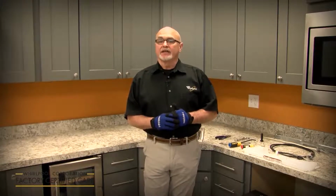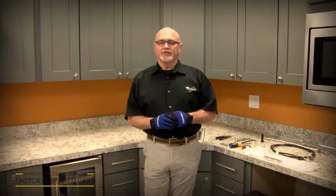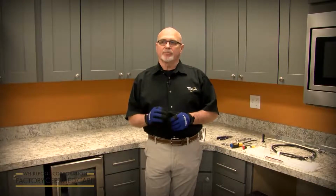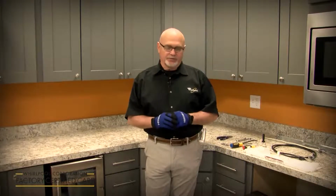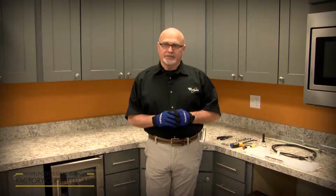We've got a taller tub. The drain hose connection is new. It's got a 110-degree elbow. We've got 4 new insulation anchor points for the insulation blanket that goes around the dishwasher, so when you push it in the cutout, it doesn't bunch up on you. We've got 4 new leveling legs.